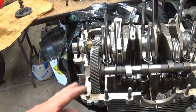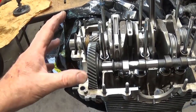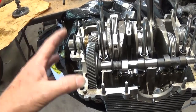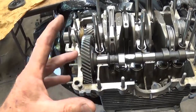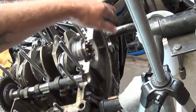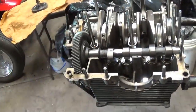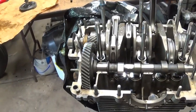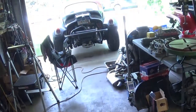I feel that the aluminum cases were made specifically for the stroker cranks. They were made to accept an 86 stroke crank, and it was made that way. They added extra material behind number three. They filled it in. They didn't do any welding. They deep set the stud and made it out of a harder material. To me, I think that makes sense, and I proved it to myself.